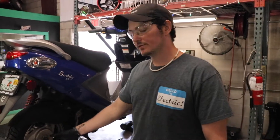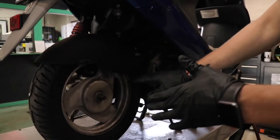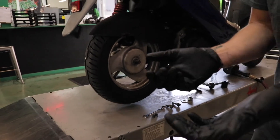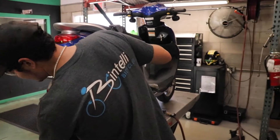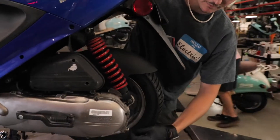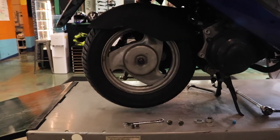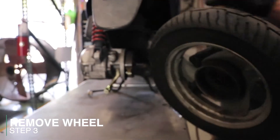All right, you got that off? So this is off. One of the other things you might want to try - the rear brake drum sits right inside this wheel well. If it's super worn down and needs to be replaced, it's not a bad idea to loosen that cable - it'll help your tire slide off. You can loosen this up a little bit on this side. As it tightens down that brake gets smaller and smaller, so when it's nice and loose it'll slide right off. You may have to lift this lip up a little bit - the tire will come right off. There's our wheel.